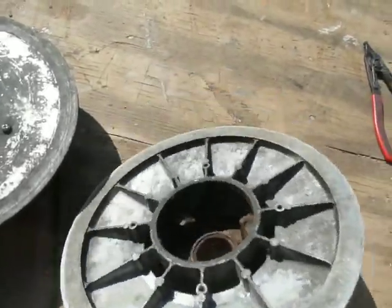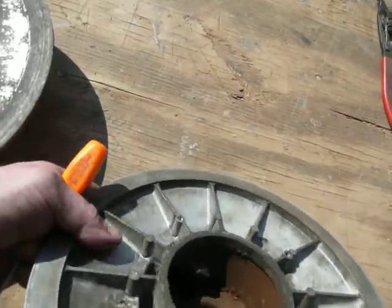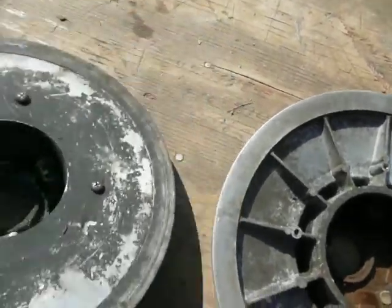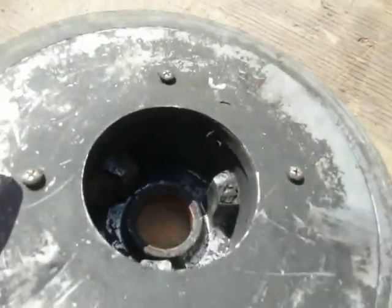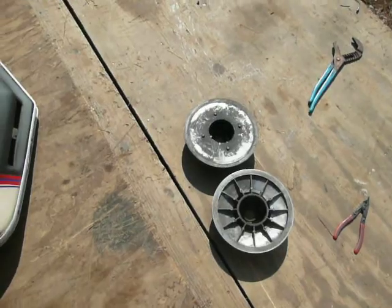I'm going to tilt this secondary forward so you can see inside there where the buttons are totally worn out. Just a common problem on Arctic Cats, Polaris, it doesn't matter. Bombardiers, the whole nine yards. Here's another one. You can see as I spin it, it's basically metal to metal. They're trash. They're dog food, basically, unless I can get some bigger ones in there.